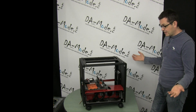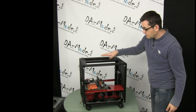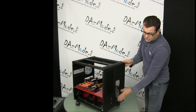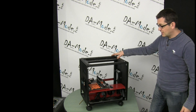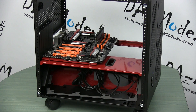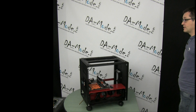Now that I know I need two triple radiators, I need to figure out where in the case I can put them. There's one possible position, another position, a third position, and even a fourth position in the front if I want. My original selection — discussed with Case Labs — was to put one radiator on top and one in the bottom chamber. That already gave me the positions of both radiators, and I already know where my ports will be, since you can put radiators one way or reverse them 180 degrees.